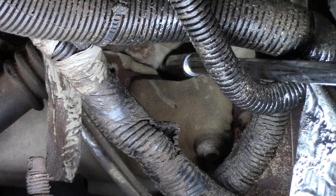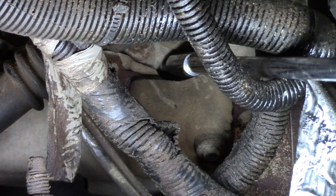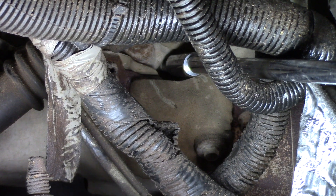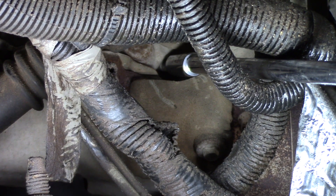Now that we have the wire connector removed and the nut out of the way we can access the glow plug — you can see I already have the tool on there. It's going to be a 12 millimeter socket with a pretty long extension so I can get through these wires without needing extra wobbles. We're very fortunate this glow plug broke free easily, but keep this in mind: if you have any resistance when first trying to break it free, put some penetrating oil on it, let it sit for a while, then go back to it. The last thing you want is any thread issues or the glow plug breaking off down into the cylinder.